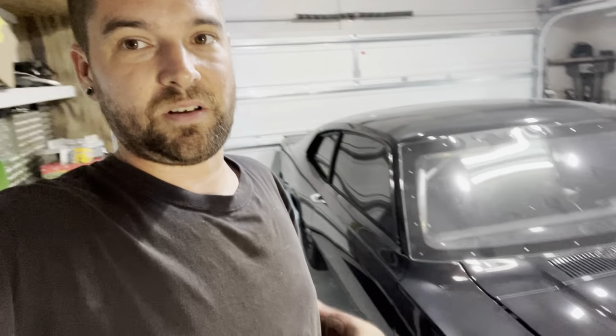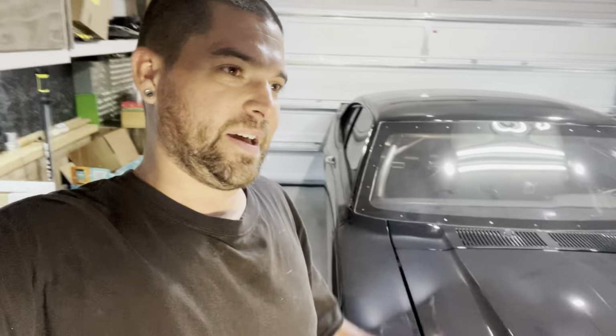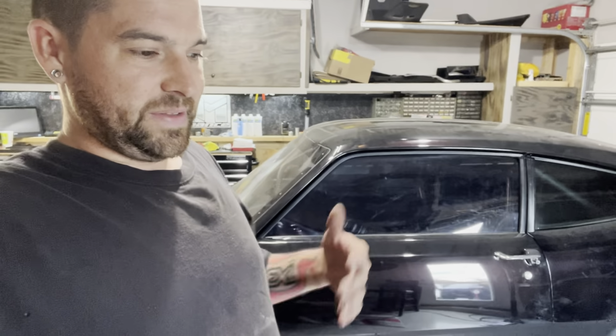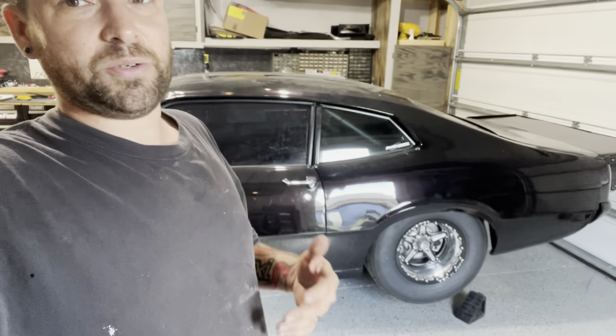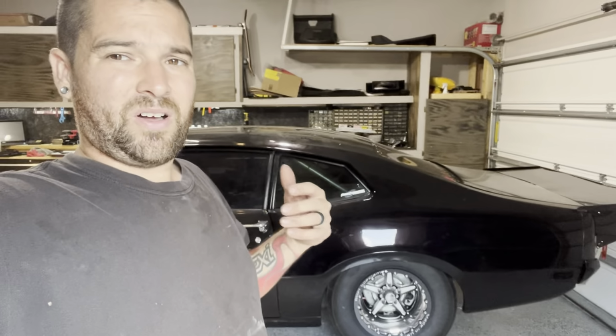All right, so it's Saturday and I've been working on the brakes all morning. The wife actually helped me, so that was pretty cool, and we got them bled. We had a couple of leaks. It took forever to get them pumped through the system, to get air out to the actual calipers. But they had never been done. There was no reason to do any of that whenever the car wasn't ready to go. So all the brakes are bled on it.